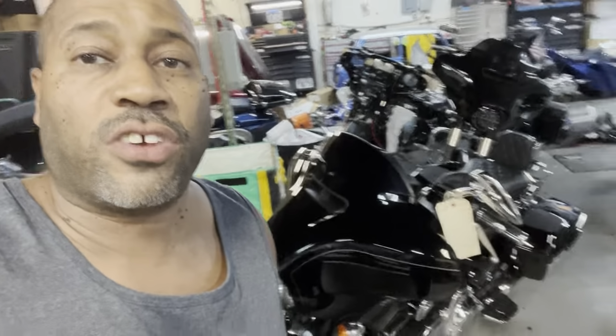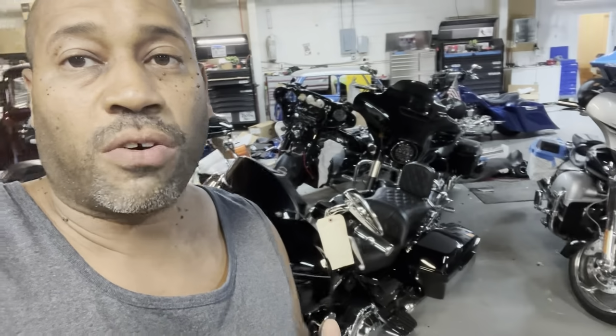The client kept having issues where the audio would go in and out. He had no idea why. They used some cheap wiring and some trailer connectors that weren't making good connection. Then they put the amplifiers in the fairing, and instead of using a water cover, they tried to silicone the edges of the amplifier and use cellophane tape. It was just really, really bad.